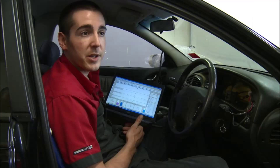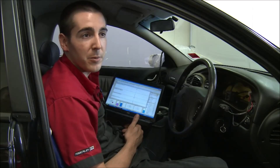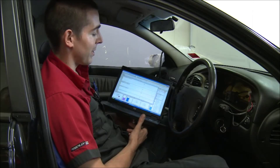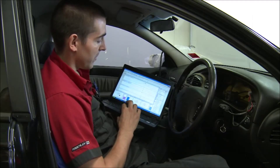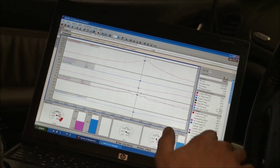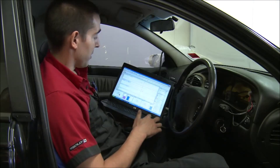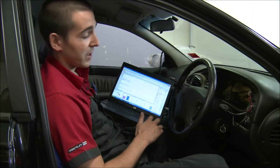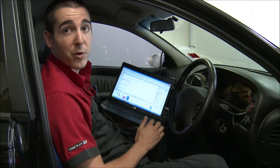We've just done the first shakedown run. We just ran it off the actuator — no boost control — and it made 950 horsepower with no dry ice. The first thing we do after we spin up a car like this is check the data. The good thing about this car is it's got an M800 MoTeC computer, which Marty wired in pre-Summernats last year. That lets us monitor everything in the engine — RPM, fuel pressure, oil pressure, oil temperature, throttle position, all that sort of stuff. After the run we go through it and check everything: lambda from bank to bank, boost pressure, intake temperature — just make sure everything is as it should be. If everything's good, we'll add more boost, put dry ice in, and make more power.